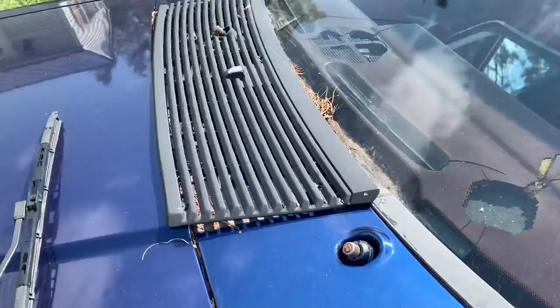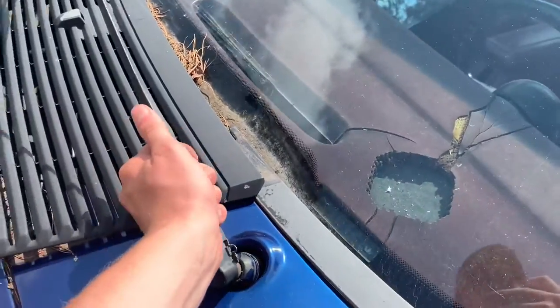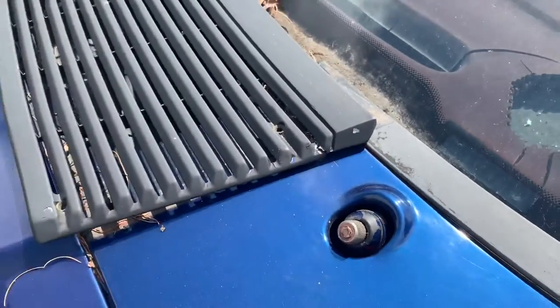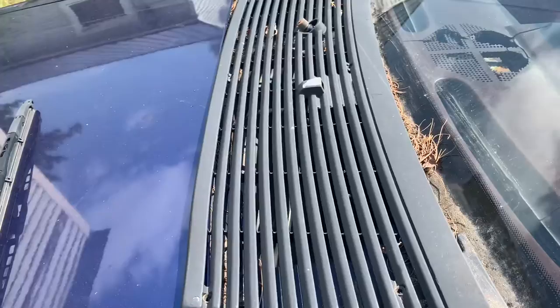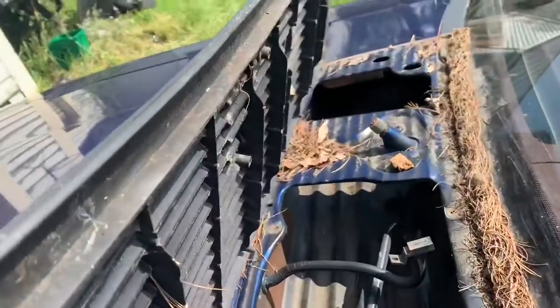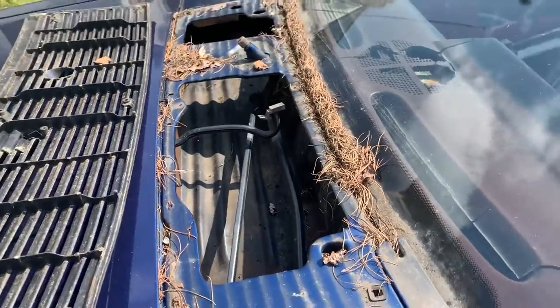In the process of trying to find a spot for this cooling tank, I just took the windshield wiper tank right out — it's dirty, it's old, I'll replace it later once I get everything working with the windshield wipers. I took it right out and pulled the whole tube out. I ran into a snag at the cowl, so just so you guys know, in case anyone ever has a question on how you take the cowl off — I've already got the cowl off. The windshield wipers is what would confuse you at first. That little tab right there goes in and out, so use a flathead screwdriver, pry it out, and you can pull the whole thing right off. CJ Pony Parts has a good video — I'll link it in the description. Once you get to the cowl there are about six bolts; little Phillips head, easy to get them off. Once you pull it up, right there where your wash fluid hose would connect, one Phillips head and boom, it's off. It's pretty good to take this off and get it all cleaned up.